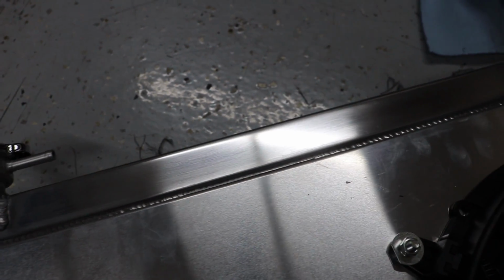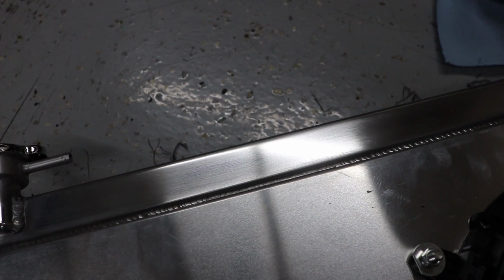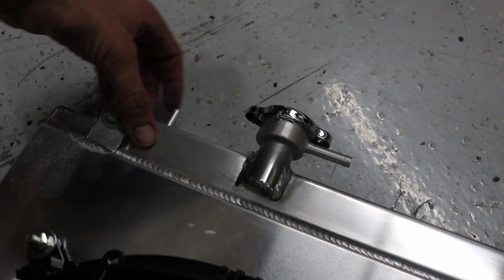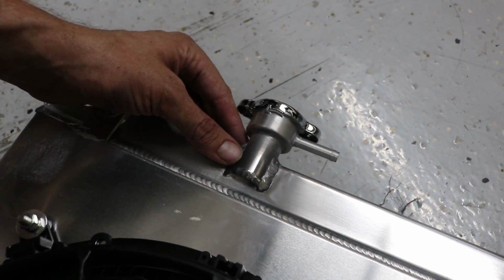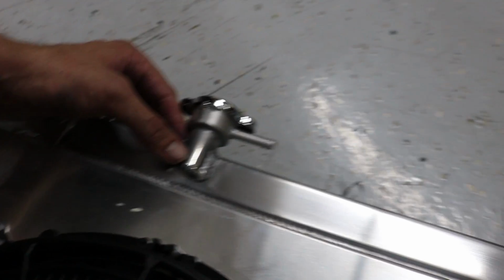What I'm gonna do is I might end up sanding this with maybe 3000 grit, and then go over it with this buffing wheel or polishing wheel, whatever it's called, and try to get all these residual scratch marks out, because it looks like this was sanded at the factory with some type of sandpaper. And you can see right here how there's a little bit of a polished part right here as well.